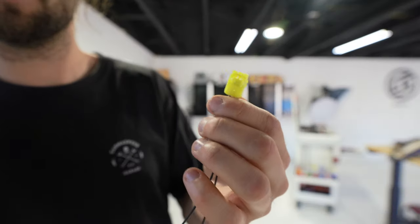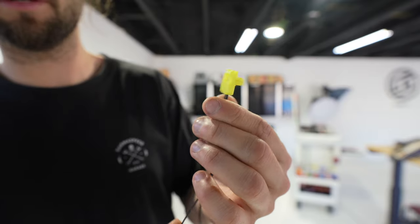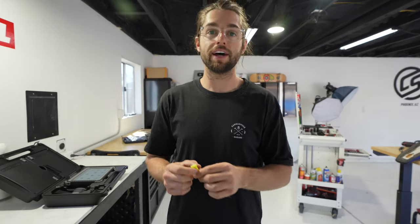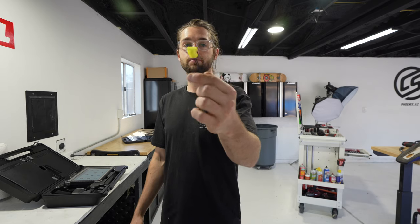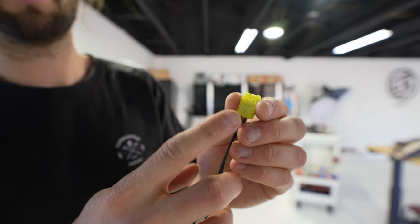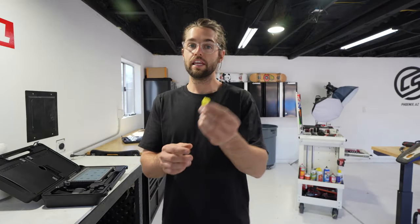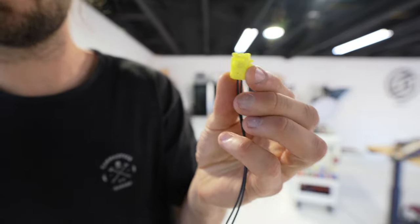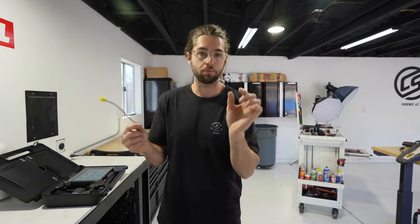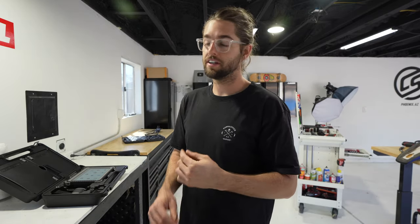Worst case scenario, you get an airbag light and you can't figure out what it is — that was me. Here's a story about how I fixed it. There's a little clip on your passenger seatbelt. There's usually a black retainer clip, and if you don't have that it'll throw an airbag light. I accidentally broke it — and this is a $90 setup on some websites, but I found it for $9 on eBay. I pulled the black retainer clip off, popped it in my plug on my car. Even though when it's plugged in without the little clip it feels secure, it doesn't have a good connection. You need that tiny little black clip — you have to get it out with a pick. That was causing the airbag light.